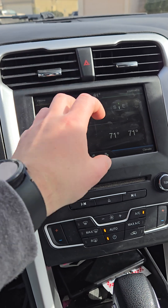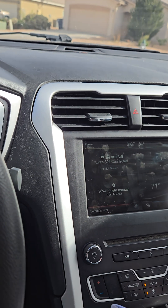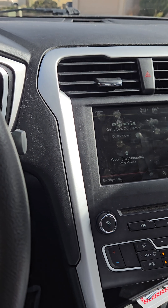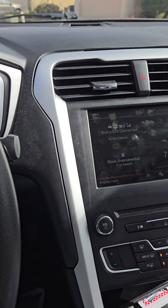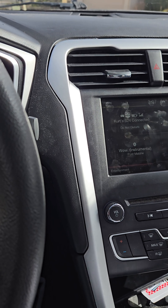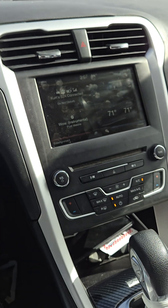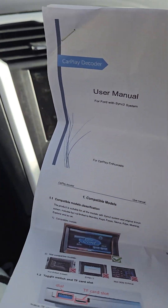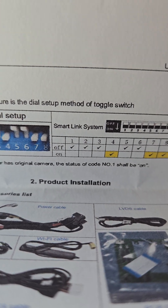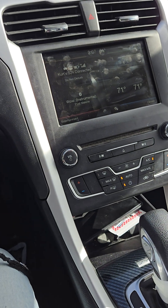I have the manual here but they don't show much about the connections at all. A tip I learned while playing with this: if you have a reverse camera, make sure switch number one is on. Turning that first connector on will enable your backup camera, and the backup camera still works.